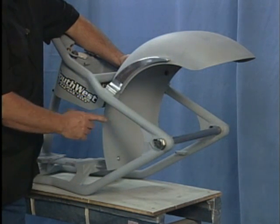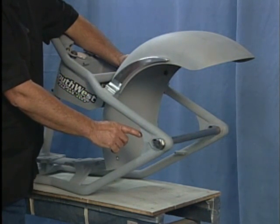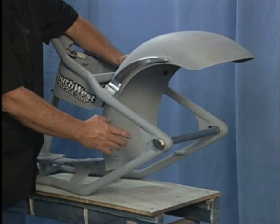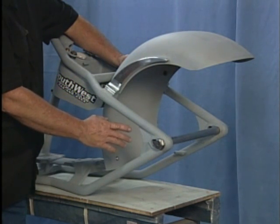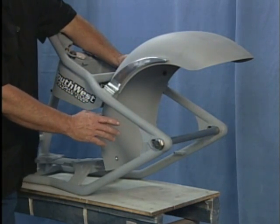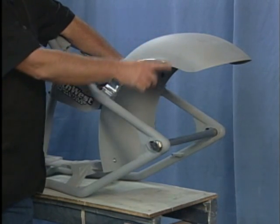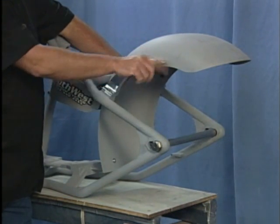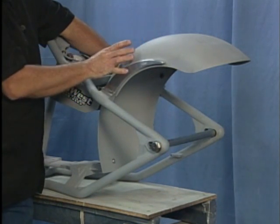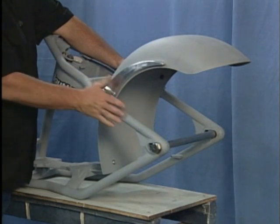You don't need to install the belt prior to assembly of the swing arm as you do on a soft tail. The Pro Quad is basically the same — you do not have to install the belt at the same time you assemble the back of the bike. This has a fixed rear fender, and sometimes there are struts or fins coming back to support the rear fender. It's called a hard tail mount — everything is mounted solid to the frame.